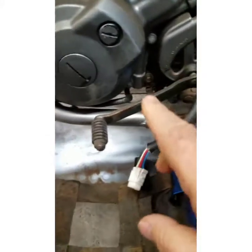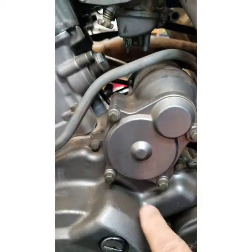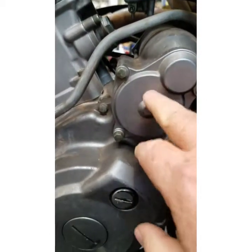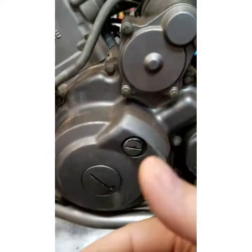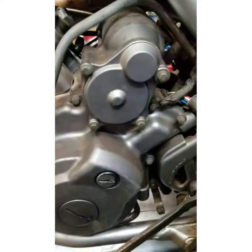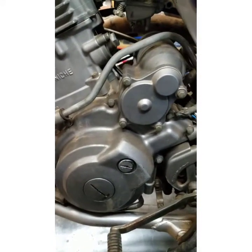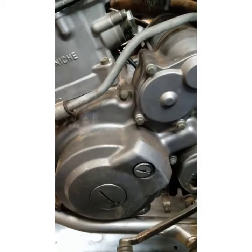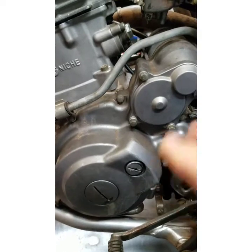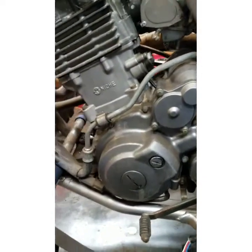To replace it, the motor oil comes out. These four bolts to get the starter gears out here. The bolts around the cover, get them out. And then when I get that done, I'll show you what's involved in changing out the stator and the pickup coil. That's a pretty straightforward process.